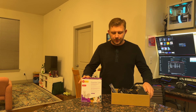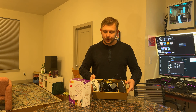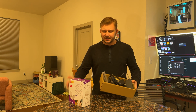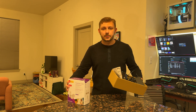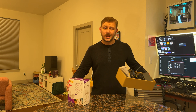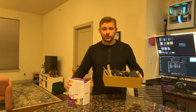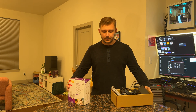To summarize: both are very useful technologies with their time and place. Power line is good if you don't have any coax and you just need something wired that gives you consistent latency — maybe not super fast speeds, but great if you're gaming and can't run an ethernet cord or don't have coax. If you have coax and can't run ethernet and want good speeds and decent latency, MoCA is your way to go. On pricing, power line runs about a hundred dollars and MoCA runs about two hundred — quite a big difference. A regular ethernet drop is probably a hundred to two hundred dollars by itself, but MoCA gives you comparable speeds of gigabit to two-and-a-half gigabit.